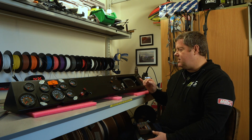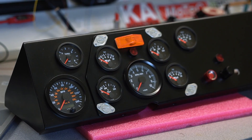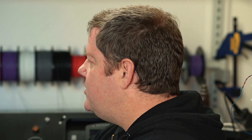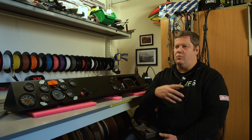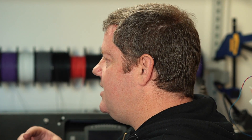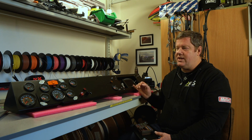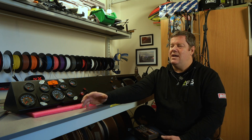What we've done is link the engine ECU to the dashboard, and the dashboard actually drives the individual gauges. I've made two-dimensional tables to output a signal from the ECU to match up with the corresponding markers on each gauge, so I don't have to add extra sensors to the vehicle. For example, the engine coolant water temperature sensor goes into the ECU — handles cold start and radiator fans — then gets sent across to the dashboard via CAN, and an output table makes the gauge work as if it were reading a sensor directly.